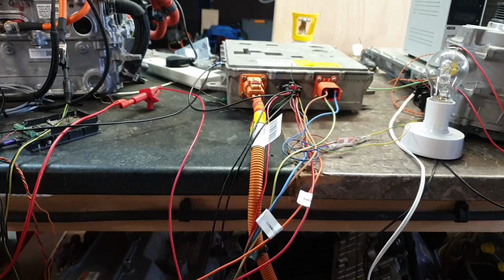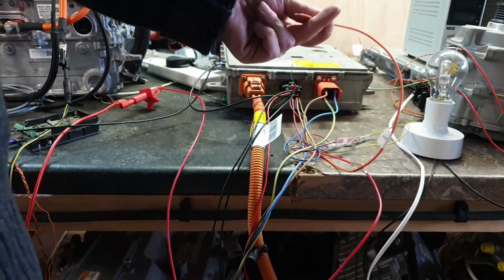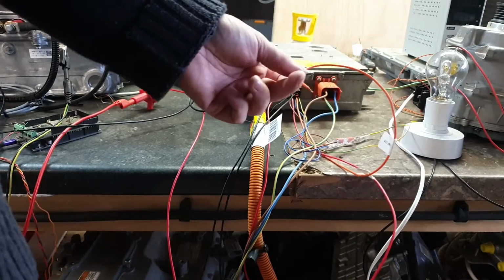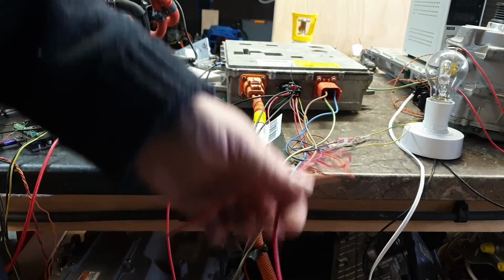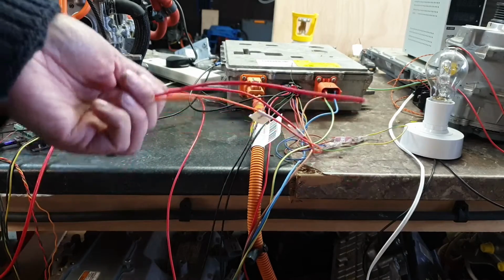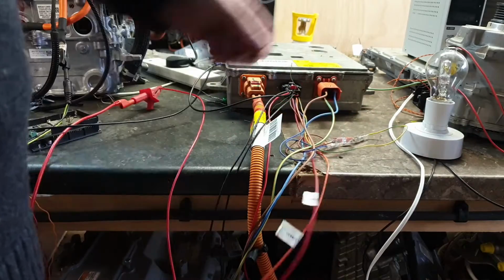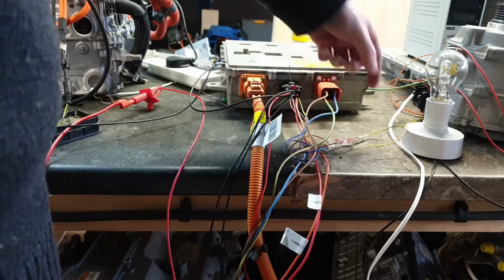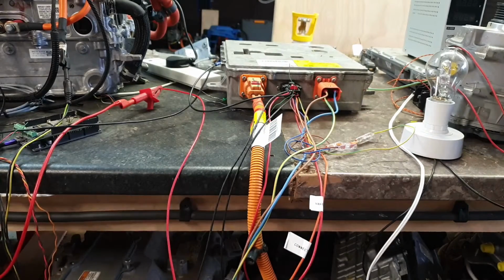Now I don't think they do nothing because this Connect Confirm is connected to the high voltage battery in the vehicle, as is this wake up. So both of these do connect to the BMS in our MG ZS battery, and they're not there for no reason, I would suspect. Finally, bottom right, we've our common wire for our charge port temperature sensors. So that's where things stand, folks, in terms of our wiring connectors here.